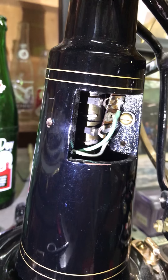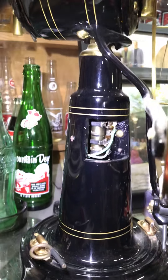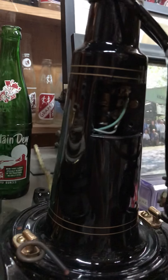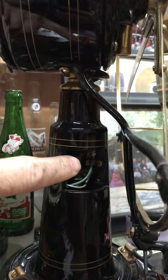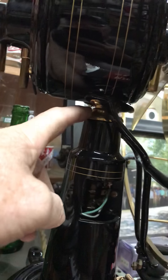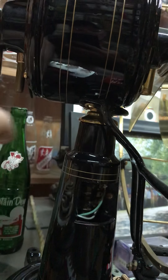Inside the neck you can see there are slip rings, and brushes ride on these slip rings. You can see as I turn the fan head how the slip ring rotates in there against those brushes. There's a bolt that comes up through here, your slip rings, and then a couple of bearing races with small ball bearings. Up top there's a little brass collar that serves as a decorative piece and also acts as a dust shield to keep dust away from the bearings.